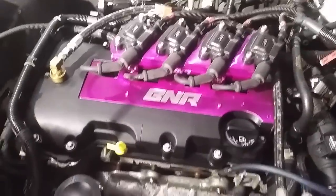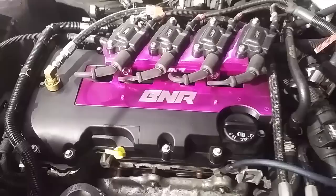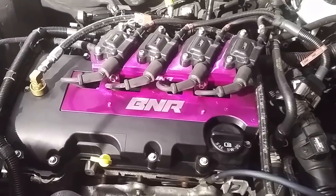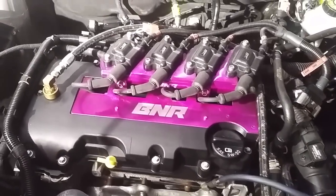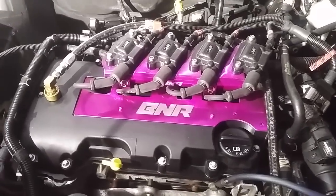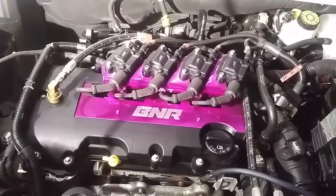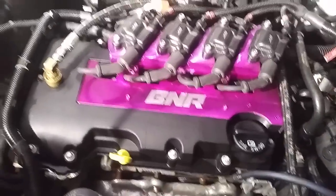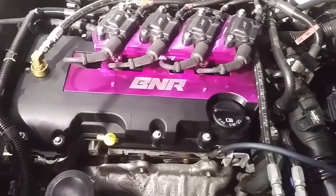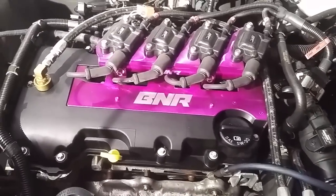The reason why I'm doing this video is because these cars all have boost leaks. I have not come across one that doesn't have one. When a boost leak occurs, you're basically dumping boost on wide open throttle, and you probably have a vacuum leak under idle conditions or when you're pulling lighter loads. Being able to diagnose a boost leak will help your car run more efficiently, help it make more power, and in some cases will help it actually operate.